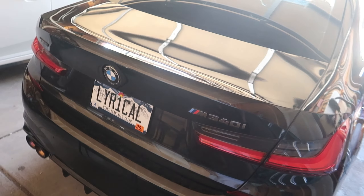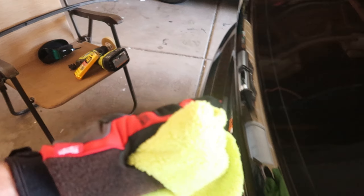I just finished up with the adhesive wheel and that thing is a lifesaver. If you plan on doing this and you don't have one of those, I would almost say don't even do it — it would take forever without it. It's strong and thick adhesive, which I'd expect from BMW to hold that little spoiler down. Definitely recommend getting an adhesive wheel. This is what it looks like now — I've got the Goo Gone right there, put it on and scrub off any excess. The wheel didn't do anything to the paint, it did a great job.